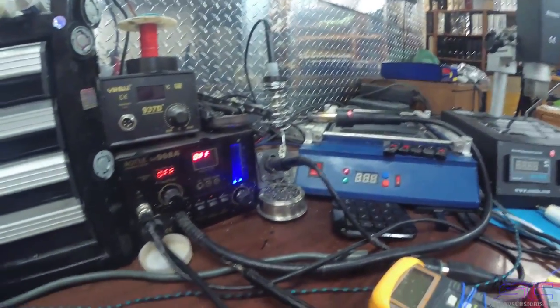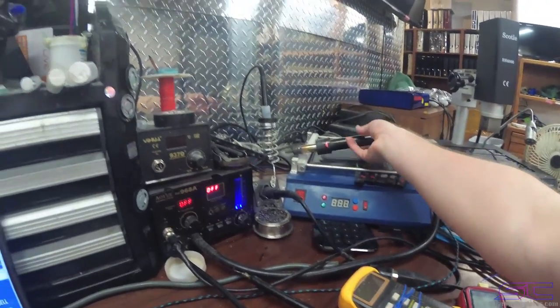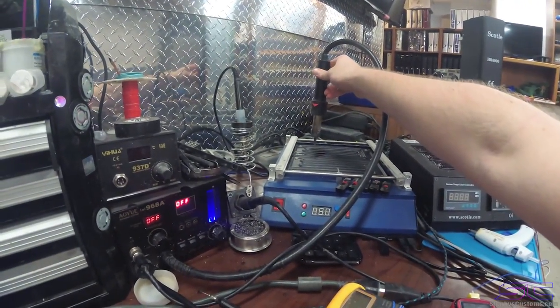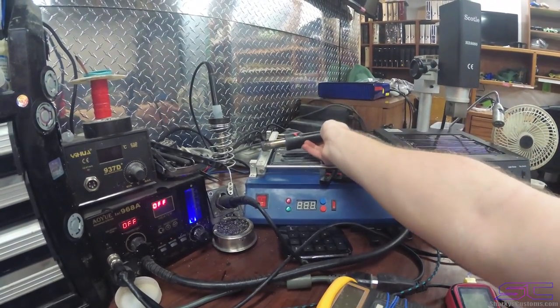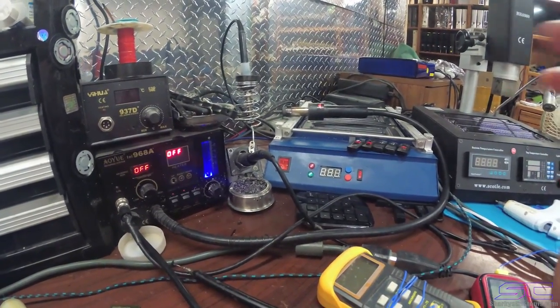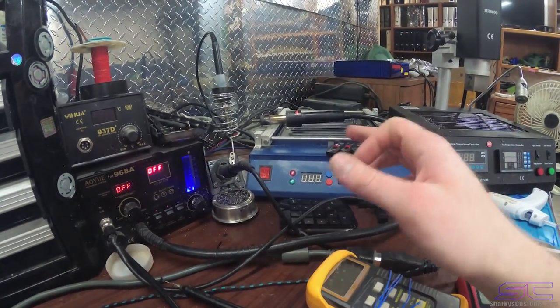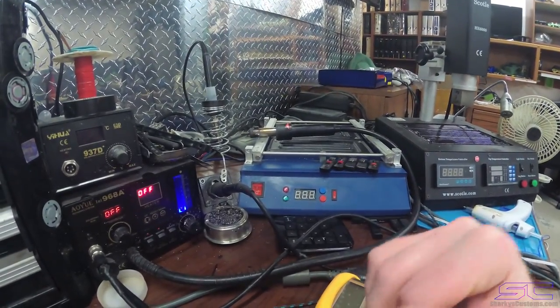So then what you would need for this is a clamping system, and you would need it to hold the hot air in place. You can look up a heat gun clamping system. The link will be in the description for that. But you can get that and use this as the bottom heater, and use the profile settings for that machine in the description that I have.